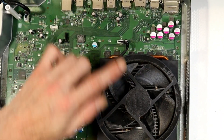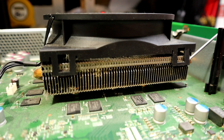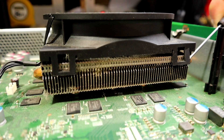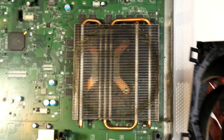After you've released those four connectors, you can remove the hard drive and the disk drive. Then we can disconnect the fan connector that's hidden under the hard drive itself. Grab a flat bladed screwdriver — there are four pull tabs in total, but you just have to release two of them, and after that the fan will just come right off.